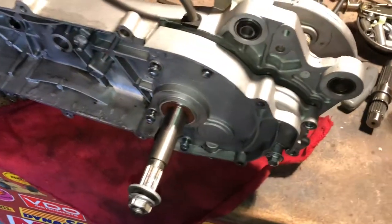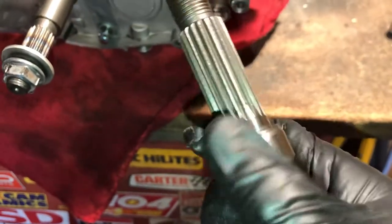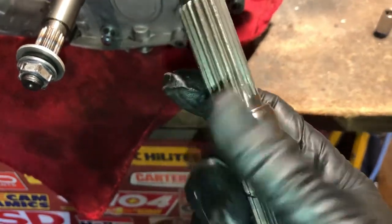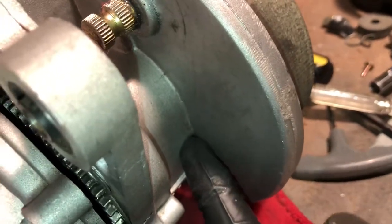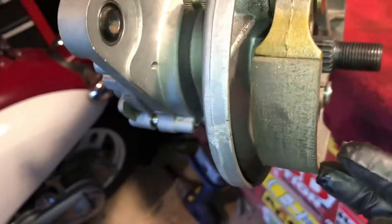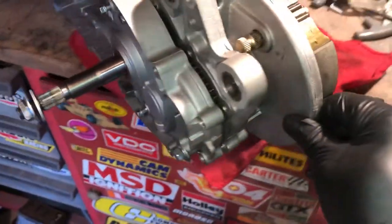So now I'm going to try to replace the axle. This part right here may be slightly out of round on the one I have in there — maybe a little flat spot or something — and it's causing fluid to come out of that little hole. If it leaks past the seal it comes out here instead of getting into this part and flinging all over your rear brakes, which are pretty bad as is. Just imagine if they were saturated with gear oil.